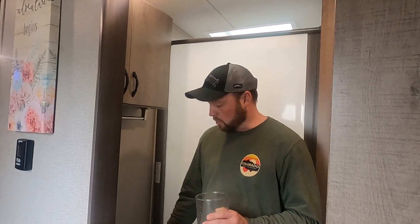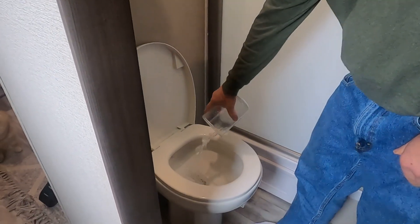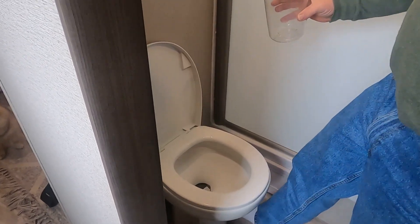Another helpful hint — when you're on your travel day and you stop for fuel, get yourself two large bags of ice, break them up really, really good, and then pour them straight down your toilet. What that's going to do is get inside your black tank, and as you're driving — slowing down, going around curves, et cetera — that's going to slosh around, breaking up any stubborn solids or toilet paper that's up on the sides. Then when you finally get to where you're going, go ahead and hook up and give yourself another good flush, and that should get the rest of those stubborn solids that didn't want to come out last time.